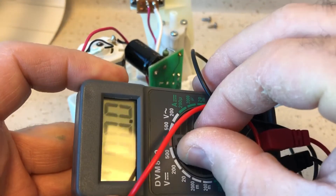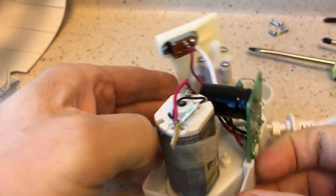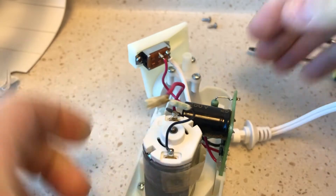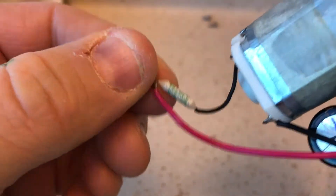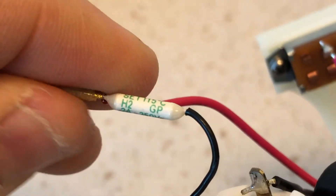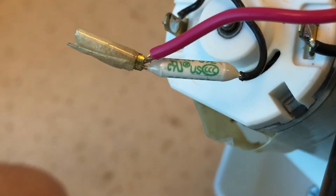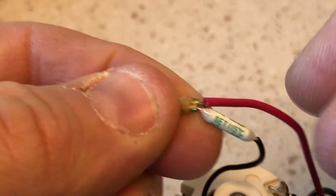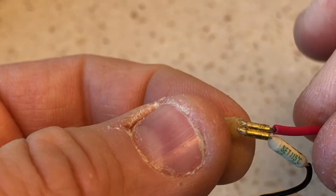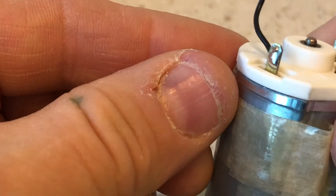If you're going to repair this thing, you've got to be sure to discharge that cap first. To summarize: we went ahead and ordered this thermal fuse. The specs are: set point 115°C, H2 GP, 2A 250V. On the other side it says T004 PSE with some regulatory symbols. It's crimped here — connected through a little crimp. You just have to uncrimp and replace the fuse. It might be soldered directly to the motor on the other side, so that's going to have to be changed too.